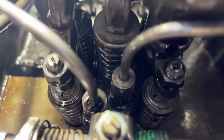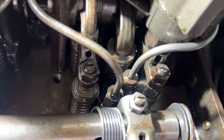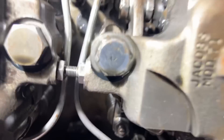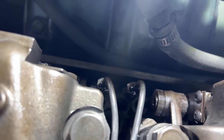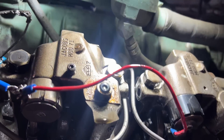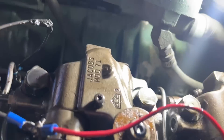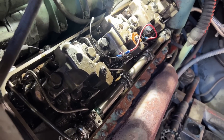That one right there is clean. That one on the right is clean. The one on the left there is clean. The one on the right has oil. Both of those have oil, and both of those have oil. So there's multiple — six of them that are leaking — and that's only on this side. Both heads were redone on this engine, so we'll have to check the other side too. But we know that's why it's making oil, because those are leaking.